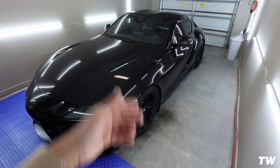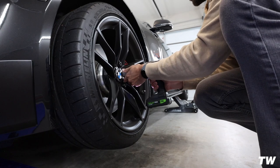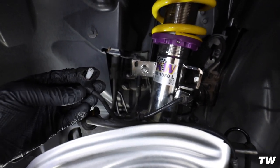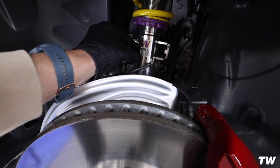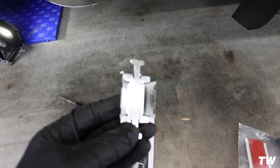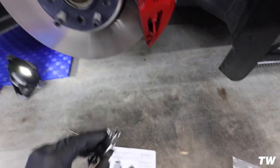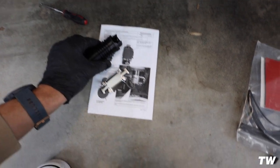I'm going to start with this side. I'll jack up the car, take off the wheels, and show you where the EDC is. Looking at the diagram and then at my setup, this is my EDC plug right here. This part carved out in the back is where the shock lies. They want you to put the 3M on this side, which will also adhere to the shock. So we'll put the 3M on the shock first, zip tie the piece onto the shock, connect it to the new bracket, and then plug it in — and that will be it for the fronts.